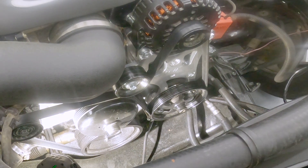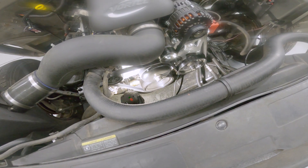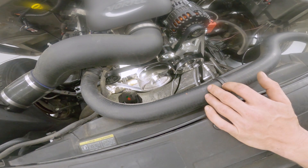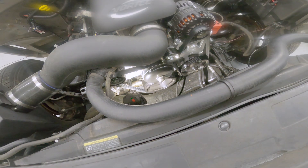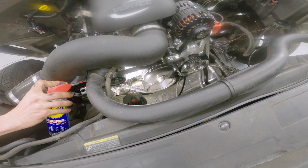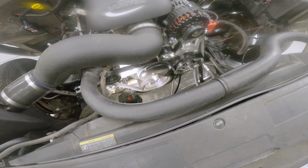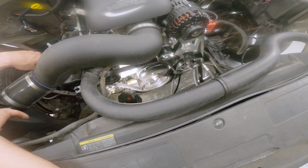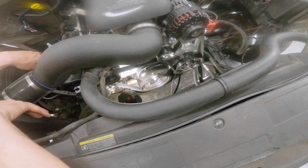Let's fire her up and see what she does. She's still making noise. Let me try to listen to the alternator and the power steering pump and see if it's coming from there, because the bracket should be tight now. Oh, that's weird — that's a first for me. It's actually not the tensioner — it is the belt itself. I put a little bit of lube on the actual belt and it quieted right down as it was going around.